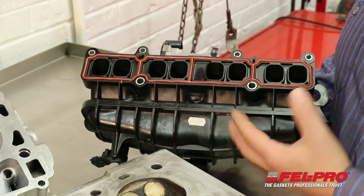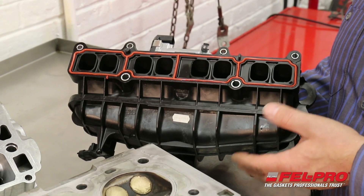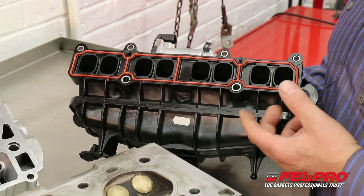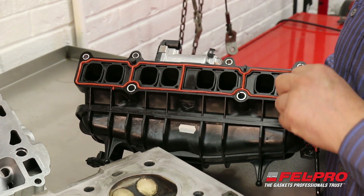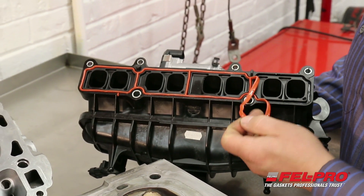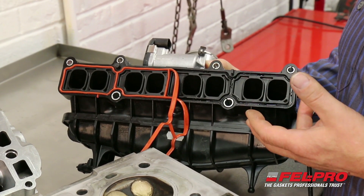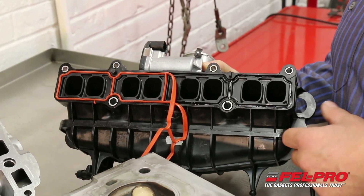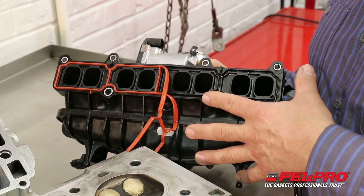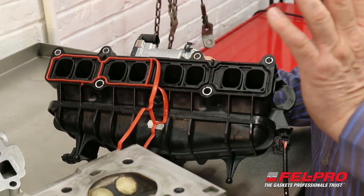In this next application, this is a plastic intake manifold — something we're seeing more and more of out there as they're trying to go with lighter and lighter castings. There's nothing here to scrape, nothing here to take a wire wheel to, you can't take it over to the bench grinder and clean it out. So basically what you do is get a small screwdriver and peel out the gasket. A lot of times you're left with some residual oil inside the groove, so you'll take it and put it in your parts washer to get rid of that residual oil. If it's still oily in there, a little brake clean or carburetor cleaner — spray that in the groove and blow dry it.